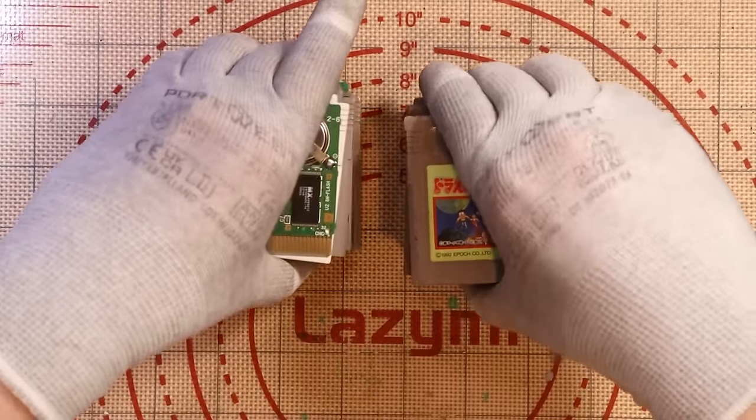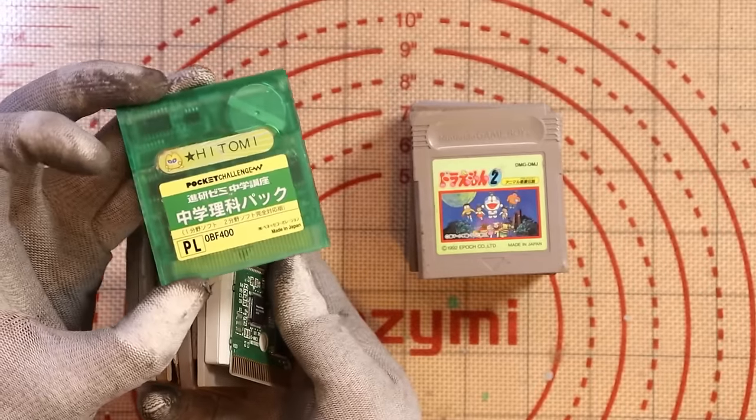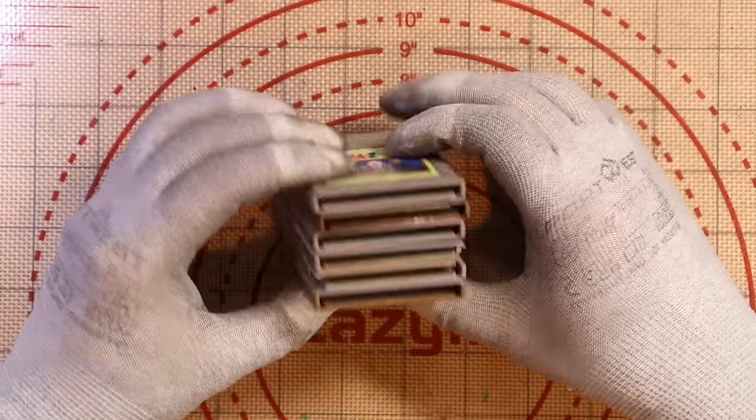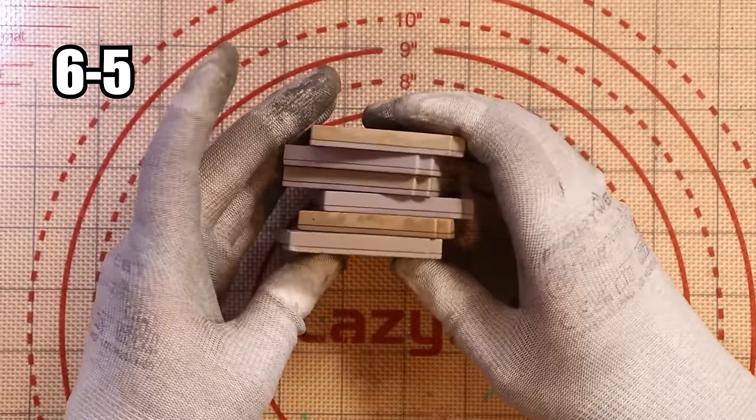We'll end it on a low then. Well, technically we won - this is the pile I wasn't able to fix, which without that non-Game Boy game included is five. And this is our pile that we actually managed to fix. So we are six to five - I count that as a massive win. Turns out most of the common issues are either just dirty contacts, or if you've got a soldering iron, just check for those dodgy pins, resolder them. You don't even need to actually use solder - just a little bit of flux, and that seemed to fix the majority of them. I hope you enjoyed this video. Hit the thumbs up button, if you're new to the channel make sure you subscribe, and I will see you in the next one. Peace.